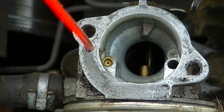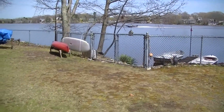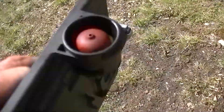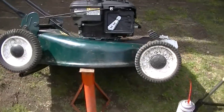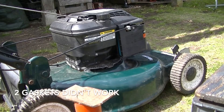It's supposed to pump gas through this hole here. I'm putting the brake cleaner in and you can see it coming out of the main nozzle — still nothing. Oh yeah, what do we got over here? Hey look, it's another one of these — I threw it across the yard when I punctured another one. I think I'm gonna need to get a new primer bulb, but what we're going to try last is two gaskets. Yeah, same deal. Let's see if it starts up.